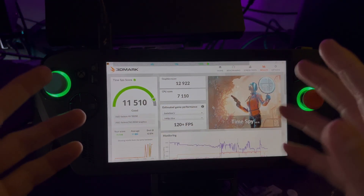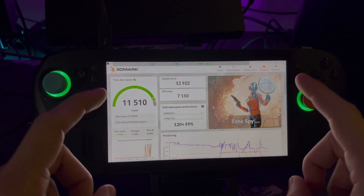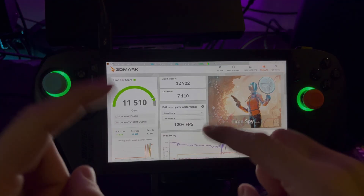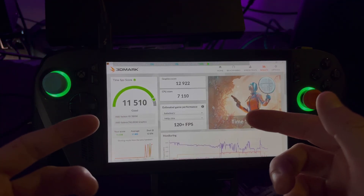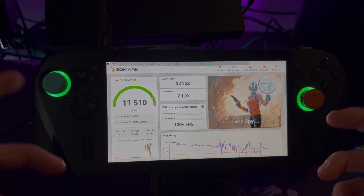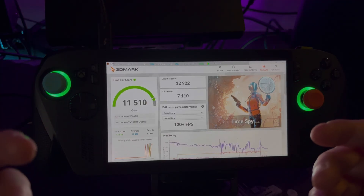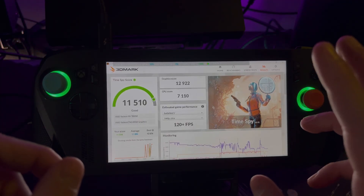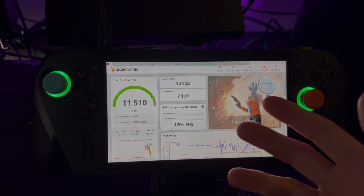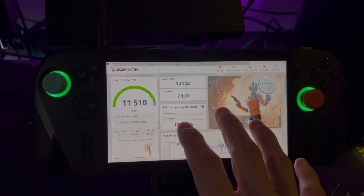Here are the test results — the score is pretty decent. If you're using an external monitor, you'll actually get better performance. Make sure you connect the display port to the One X GPU and not from the device itself — if you connect from the device, you're not going to see the gains you should be getting. Connect it directly from the eGPU dock or from the graphics card. This applies to any AMD eGPU setup. As long as you're within this score range, you've done a really good job, everything is working properly, and you can go ahead and start gaming.